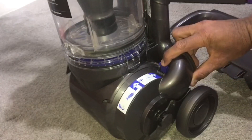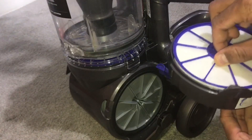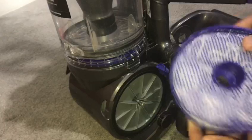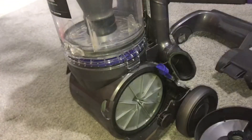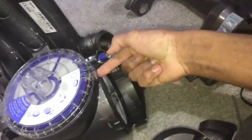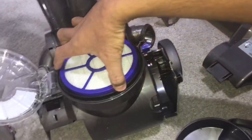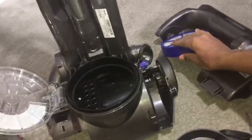Filter housing here — remove this blue filter. You need to wash this every month or so. There's a second filter in here, so push the catch on the top of the cyclone to remove the whole bin. There's another clip here — lift that up. You can wash that filter as well. Washing these filters will improve the suction.